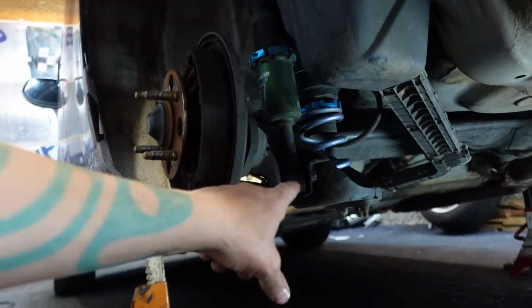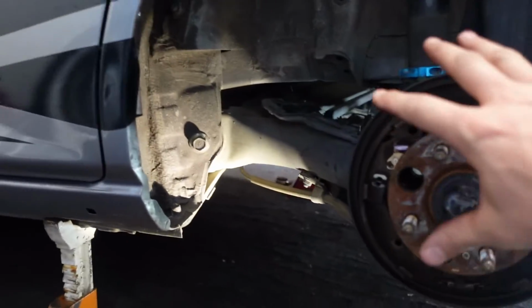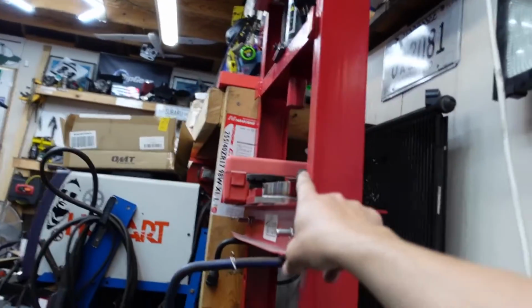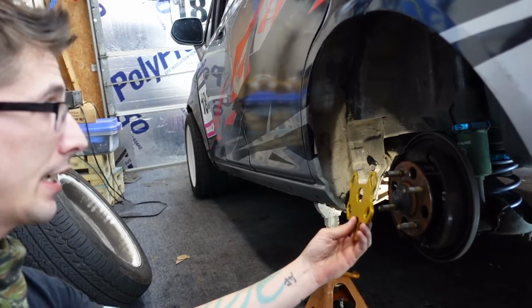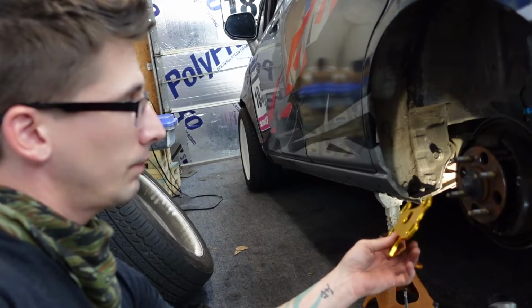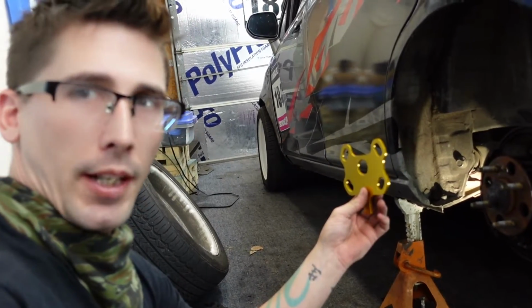I didn't really need it much for these. But even to do that, you gotta disconnect your wheel suspension, undo some of the brake lines and hoses, and essentially take half this apart. So what I'm going to do is go ahead and take the whole thing out and attempt to use my press to press them out. I figured since I'm already doing the camber shims and my whole brake assembly is going to have to be disconnected from the brakes anyway, doing the extra few steps to take the whole thing out isn't much more, I guess. Still gonna be a pain.